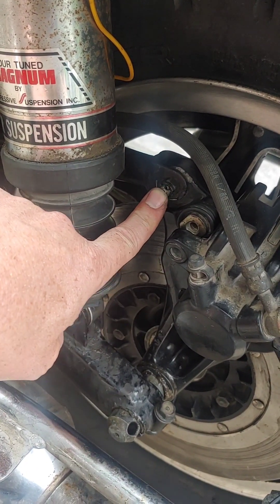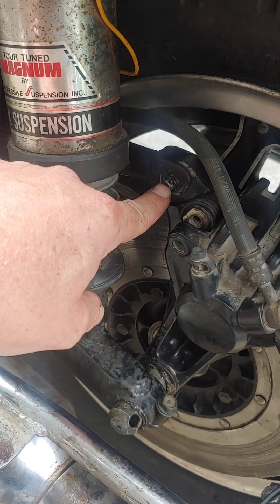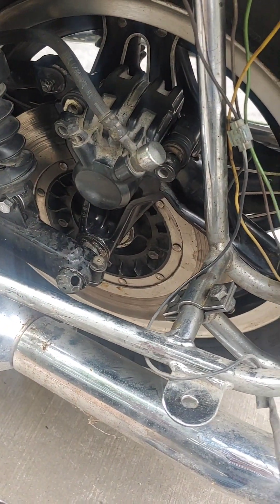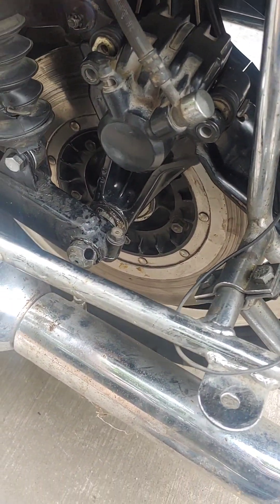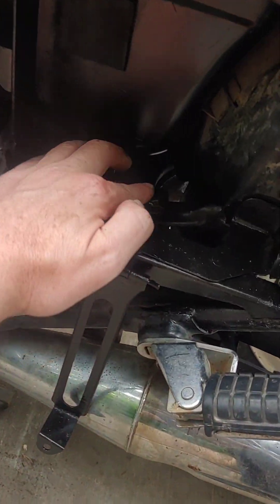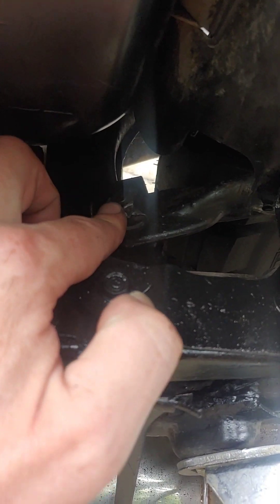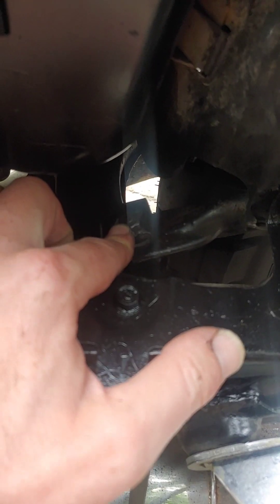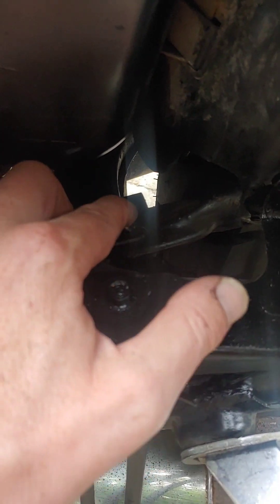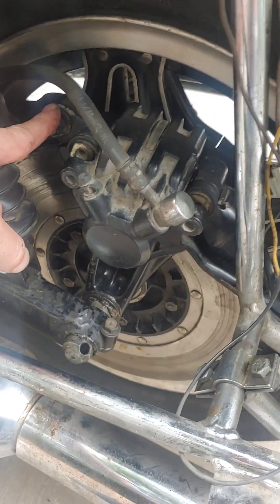Also, the next thing is you're going to need to take this bolt out — that cotter pin needs to come out, and then this unthreads; that was a 12 millimeter. So that'll come out, and then this whole brake assembly will come away. The tire will still not be free to get out. So what you have to do next is pull your battery out of the battery box. Right here is a guide arm that has a little 10 millimeter bolt with a lock clip on it that bends up — you've got to bend that down, then take this bolt out; that's threaded into the frame. Then this swing arm will come out of the way, which attaches right here to the brake assembly.